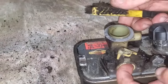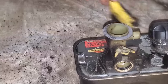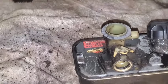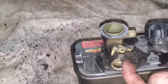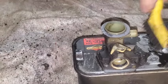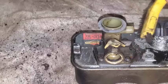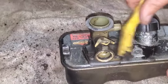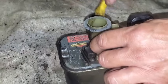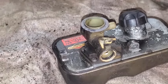if it's not in place properly, or if the O-ring's worn out, you might have to replace it. What kind of condition would that cause? As far as engine running, if you know, leave a comment in the comments. If that O-ring was bad, how would that affect how the engine's running? What say you? Go ahead and put it in the comments. Not the description, in the comments. Sorry about that. And if you want to test yourself, you can go down there and check. Because if that O-ring's bad and it would be sucking in excessive outside air, what would that cause the engine to do?